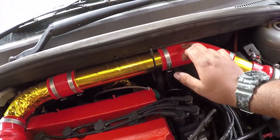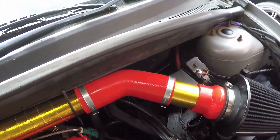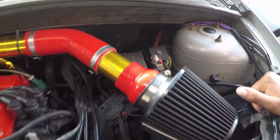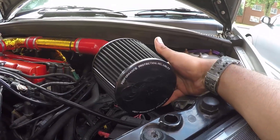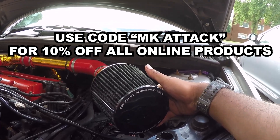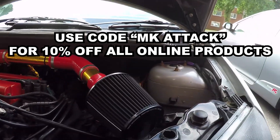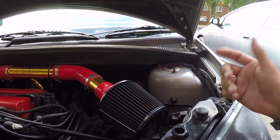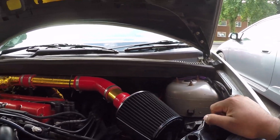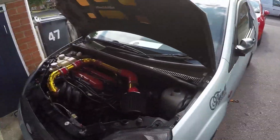I think that's a 134-degree bend leading into another 300mm cut down to go into a 2.25 to 3 inch coupler. Here we have the 2.25 to 3 inch coupler which goes to the Funk Motorsport air filter — they sponsor me as well as people like Oliver Bolton, British Drift Championship, and Monkey London. You can't see a better company to go with and their prices are amazing compared to companies like K&N and Ram Air, so you're definitely getting your bang for your buck.